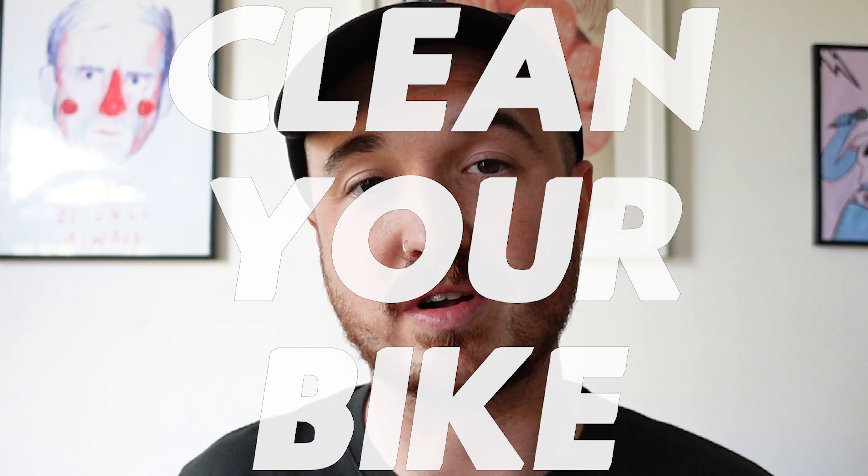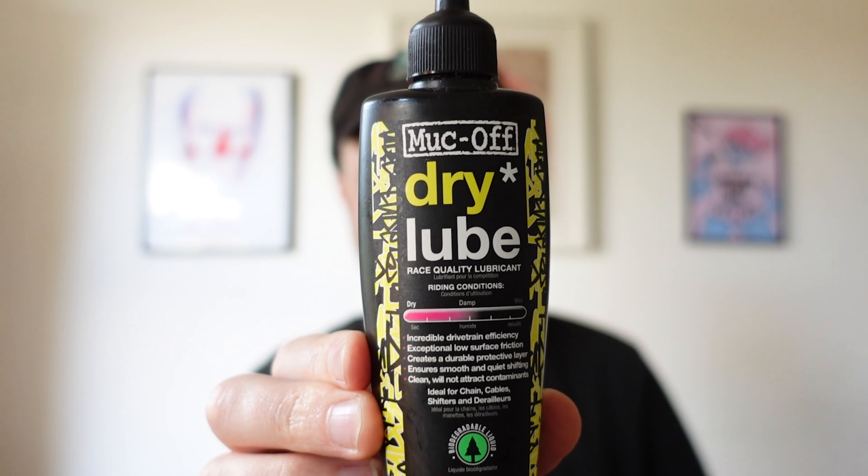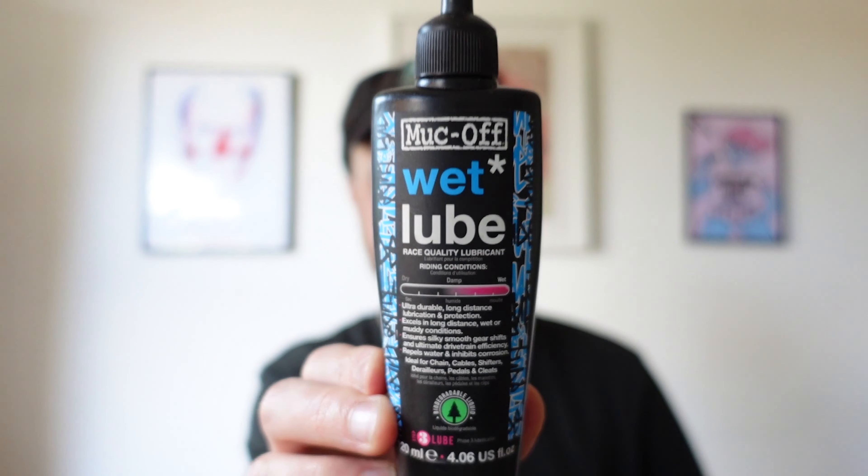Another thing worth bearing in mind is that your bike maintenance might have to step up a level in winter. In the UK we often salt and grit our roads, and that salt and grit is going to work its way into your bike, onto your chain and frame, corroding and wearing your parts faster than it would in the summer. You'll probably want to give your bike a thoroughly clean after every few rides, and after every ride I'd recommend giving it a wipe down with something like GT85 or WD40. Something I had no idea about when I started cycling was taking care of your chain — you can get chain lubricant specifically for dry situations and also chain lube specifically for wet situations. In winter, dry chain lube will just get washed off with all the rain, leaving you with an unlubricated chain that makes an annoying squeaking sound and will rust a lot quicker.